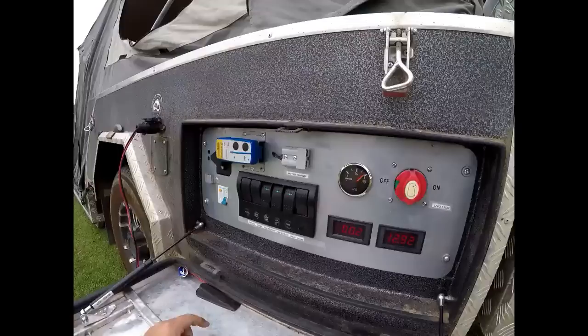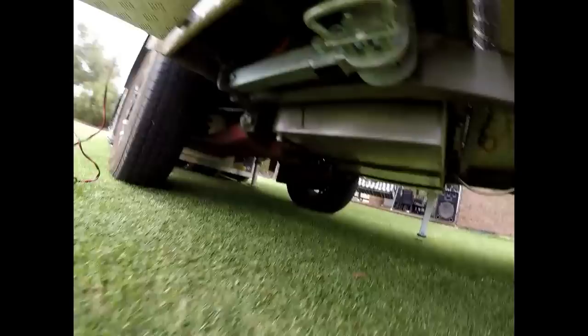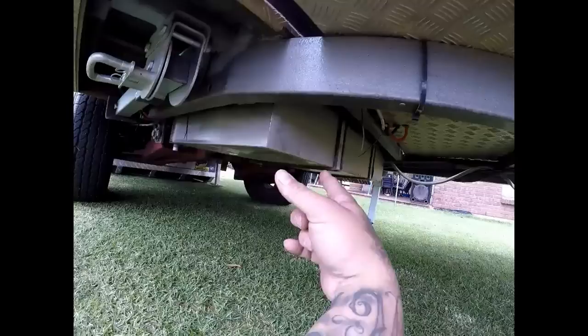As standard they give you a water pump that feeds the kitchen and a gauge for the 80-litre water tank underneath. I've actually added another 80-litre tank that I still need to put a bash plate on. The two lowest points equalise together - they both use the same gauge, both equalise, both have a separate filler, and the breather is teed into the original.